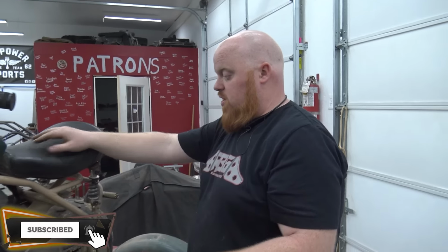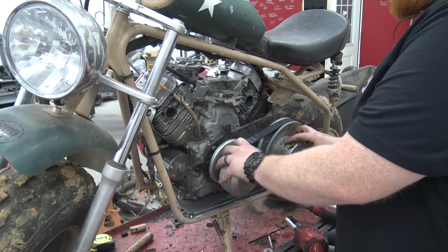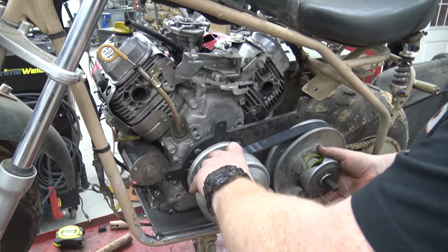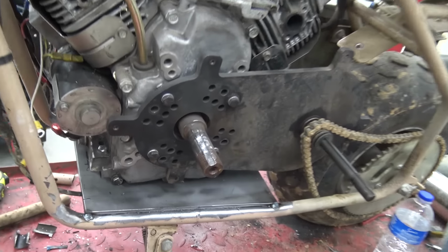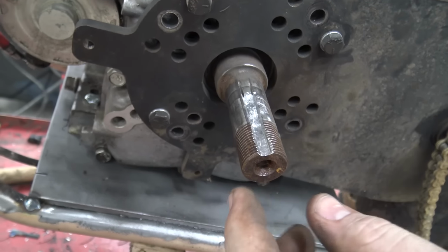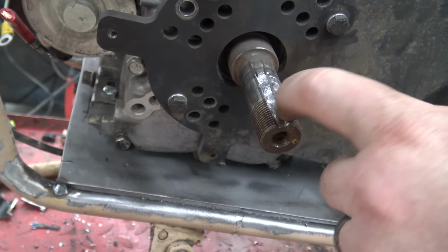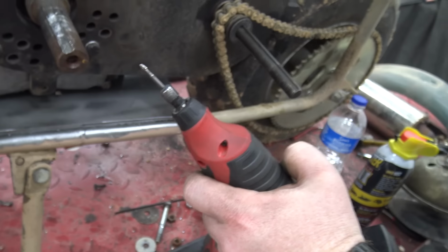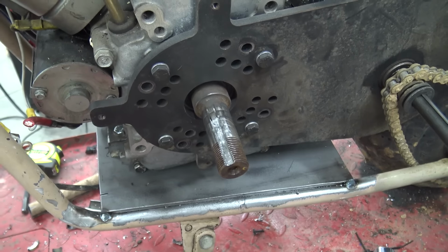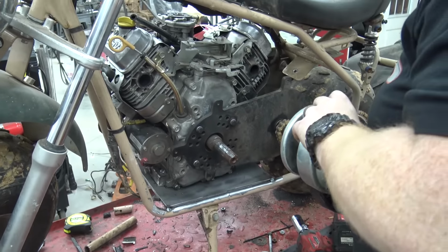Oh yeah, it's good. We got tension to the chain still. But then, if you remember, this was a threaded crankshaft. It wasn't tapered, it's just threaded. I don't even know how that holds something on. It makes no sense to me, but we took a Dremel with a cutting disc and I traced a key on there, and then I just cut two slits at the depth I thought on each side, and then took this little tiny deburr. It only took like 20 minutes, and now I'm pretty impressed with how we got it on the first shot. Perfect. It's tight too.